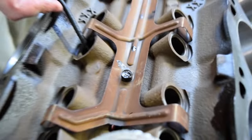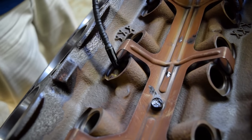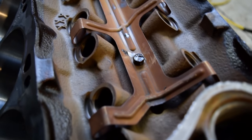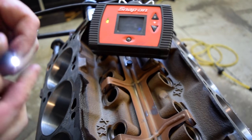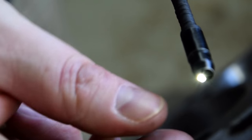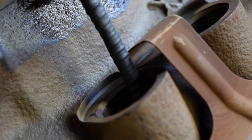There's a word for this part — the springy spider-like thing that holds the lifter spiders in. When we disassembled this thing way back when, I forgot which bolts were for it. I found some bolts that fit and thread in, so maybe they're the right ones, maybe they're wrong. Bruce thinks I accidentally grabbed oil pan bolts, but I go back and look and didn't find any that look like them. Bruce says we'll just use a boroscope to look down and make sure they're not protruding and hitting the cam. If they're the right size, we'll just go with it — if they work, they work. We take the spider back out.